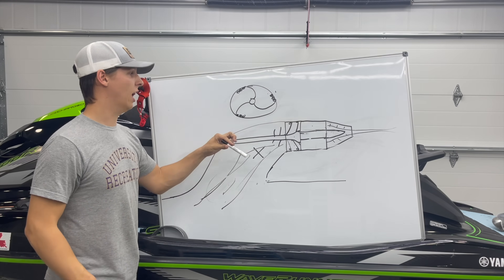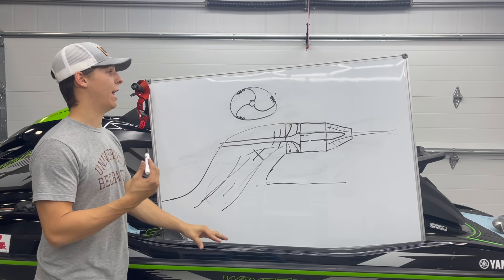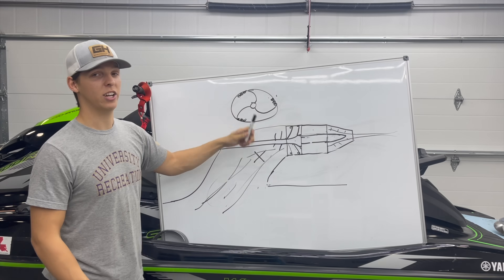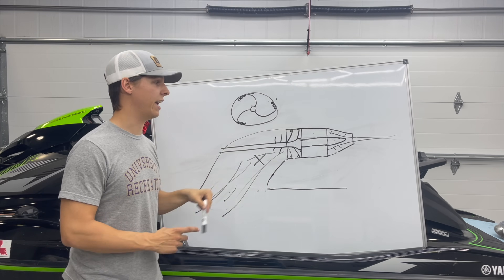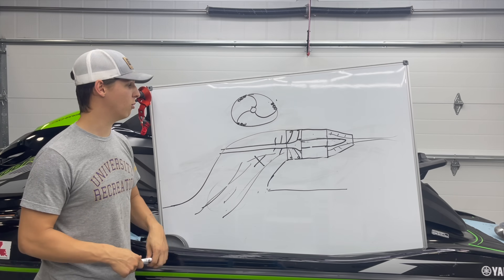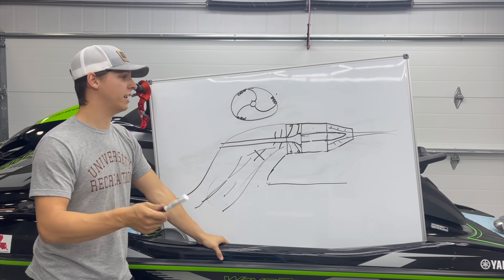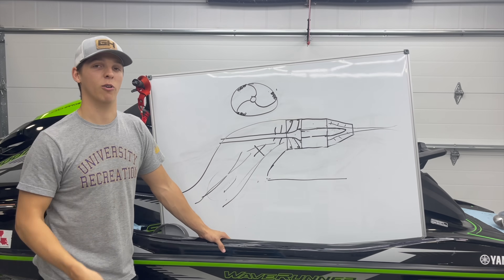The moral of the story is you need to optimize your pump setup for your horsepower level and your intended purpose with your watercraft. If all you can do is improve cavitation and not eliminate it, then you need to learn some throttle control to get the best acceleration and hole shot possible. Because if you're cavitating, not only are you doing damage to your pump setup, but you're also not accelerating as hard as you can. Take the time, optimize your pump, fine tune things to get the best hole shot possible, then learn some throttle control to ride that edge of cavitation, eliminate the risk of damage, and accelerate harder. I hope you guys enjoyed this video — leave a comment if you enjoyed it so we can do more videos like this.